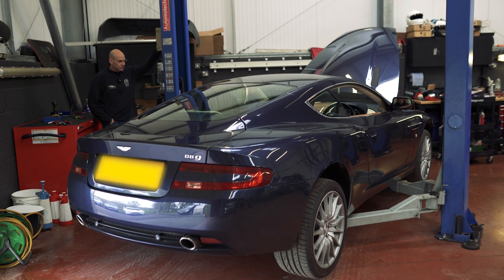We have a car in the workshop making a ticking sound, and we're going to show on an engine block with some hardware exactly what's causing this sound, and then touch on the rectification. Unfortunately, with a tick to this extent — piston slap in liner and the small end bearing — this is going to be a comprehensive engine rebuild. It comes down to parts and labor cost versus a complete remanufactured engine from the factory, which gives you two repair routes.